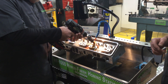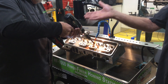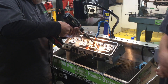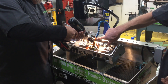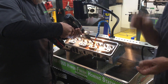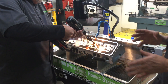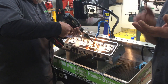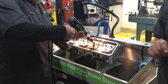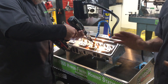I'm going to ask Paul to go ahead and start honing on this valve guide. It's just a simple, direct process — as you can see, we're using just a battery-powered thumb-grip drill. You can run an air drill if you like, but a lightweight battery-powered drill means you can feel what this diamond hone is doing. You want to be able to feel that, because when you're chasing those final couple of tenths to get that guide on size, perfectly round and perfectly straight, you'll want to feel that tool all the way around.